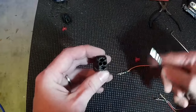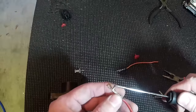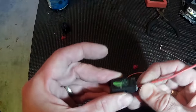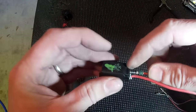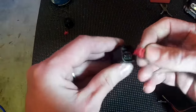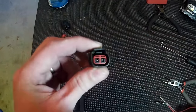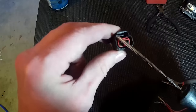I'm not sure what happens if you mix them up, but I don't think it's going to be good. This little opening here — there's a little opening right here — this goes in the up position towards the tab. So you just want to push that right in, and it locks in there. Again, this little opening is up, and there's your tab. Just push it straight in, and you won't feel it snap or anything, but you'll know it's in when you look and you see the metal facing you right up front. Last thing you want to do — to keep those from going anywhere — is this flat side goes up on the top, and it pushes straight back down in. And you're done. Just make sure you have your O-ring in there. That seals out moisture, and you're good to go.